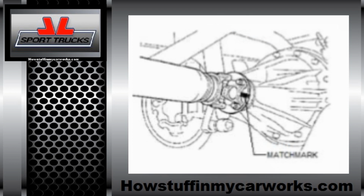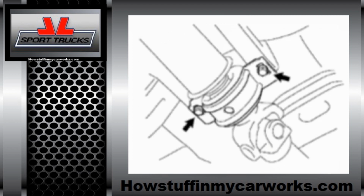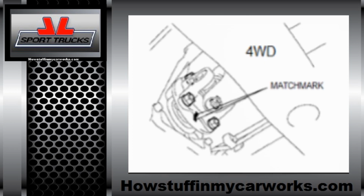Paint a mark on the drive shaft and the differential so they can be aligned again after the job is complete. Remove 3 of the 4 nuts and bolts that hold the drive shaft to the differential and leave the last one finger tight. Next step, loosen the nuts and bolts that fasten the carrier bearing so they can be removed soon by hand. If your truck is a 4-wheel drive, mark the relationship of the drive shaft to the transfer case yoke. Remove 3 of the 4 nuts and leave the last one finger tight.